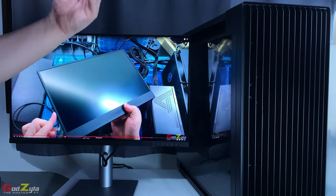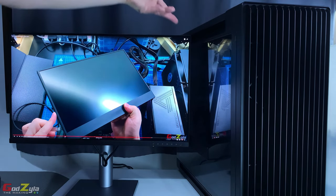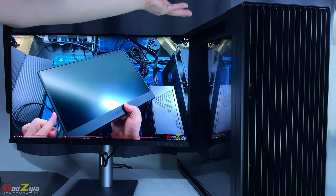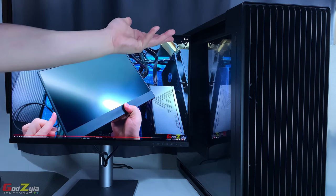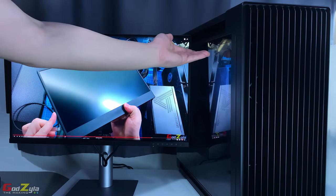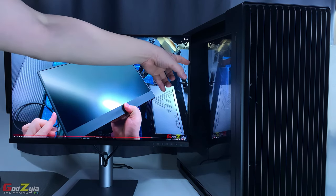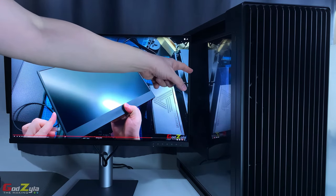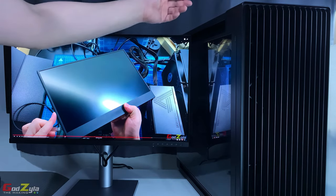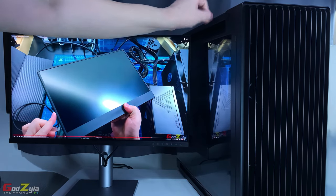Now, besides this, the functionality, like how you remove all the front, the side, the top, and amazingly, the liquid cooler, which I'm using, the 420 ProArt liquid cooler, it hides the radiator totally, which is hanging at the top. And based on the fact that it's not seated inside, see, that's the thing. If you were to place the radiator inside, all the heat that is within the motherboard area will hit your radiator too, besides the cold plate. But if you have the radiator at the external, it's exposing more cool air. So that's one good point.